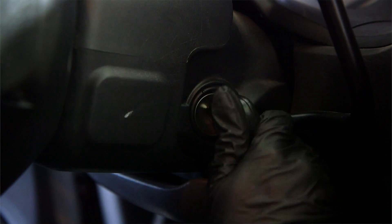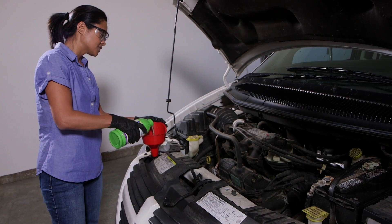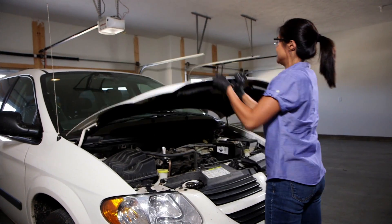This is necessary to circulate FiberLock in your cooling system. Very slowly, add the required amount of FiberLock. Replace the radiator cap. Turn the heater on to high. Let your car idle for 15 minutes and you're done.